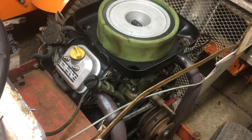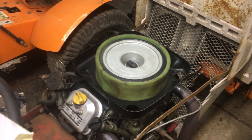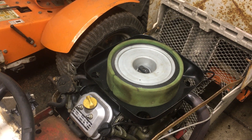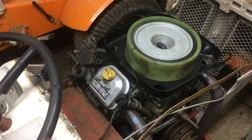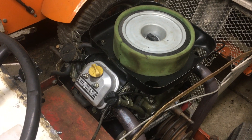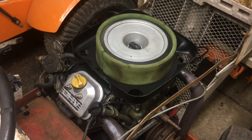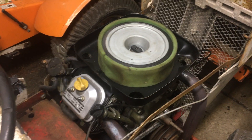I just have a bicycle brake cable on there for now — it's not the preferred way to do it; I'm going to upgrade that come spring. It does have stronger valve springs. There are spring spacers available — basically flat washers you put underneath the spring to add tension — but you run into the possibility of coil bind because of the excessive throw of the performance camshaft. Finally, this engine has Performance V Twin roller rockers, so it does not have the stock stamped steel rockers. The roller tips relieve friction inside the engine.